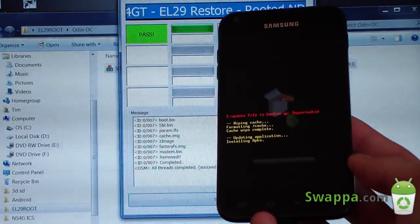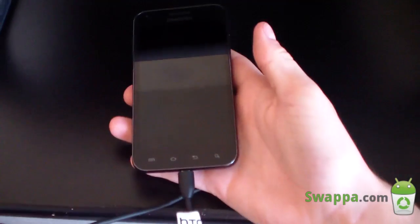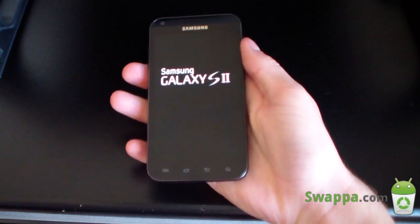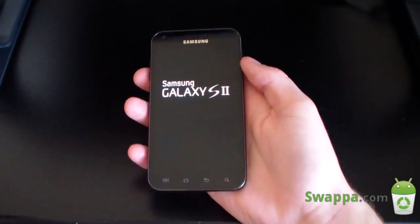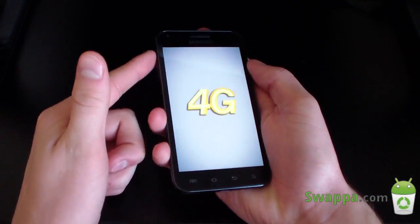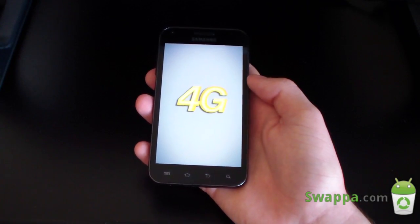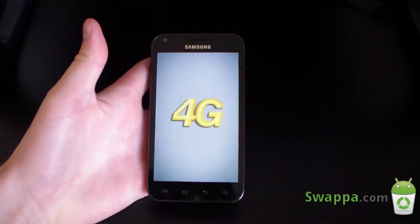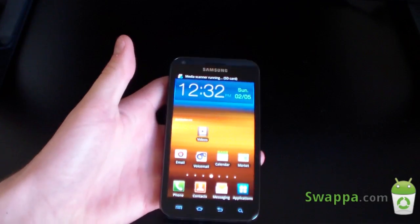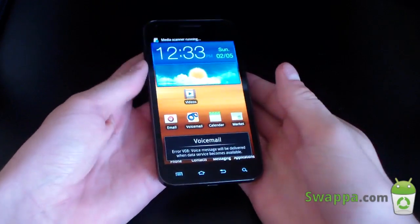Your phone is done — it should be completely rooted. It looks like it's taking you into the stock Android recovery. If it stays in stock Android recovery, when it highlights 'Reboot System,' just press the Home button to select it and use Volume Up and Down to navigate. But it should just automatically reboot your device. I used the restore option so no data is lost — I put a video icon on my home screen to verify it stayed there, and it did. All my data is preserved, but I had you do a backup just in case.